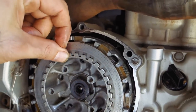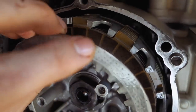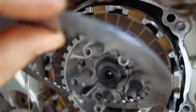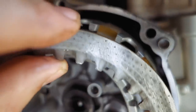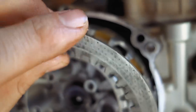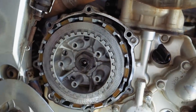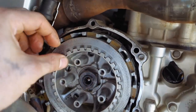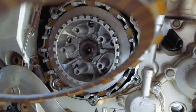One important thing with these discs - if you've got a WR, you'll notice one edge is sharp and the other edge is round. You want all the sharp edges facing out. That's supposedly pretty important for the clutch to operate properly. So I'm going to take all these out, slide them all out, and slide the new ones back in.